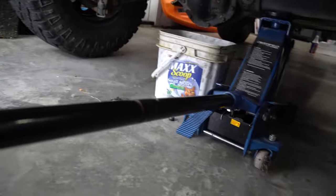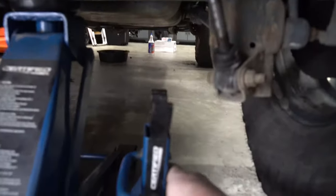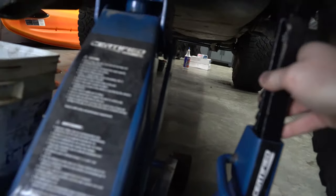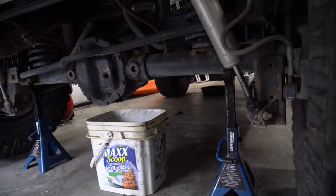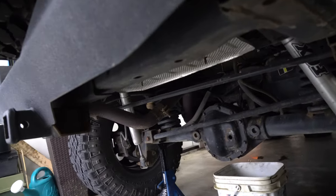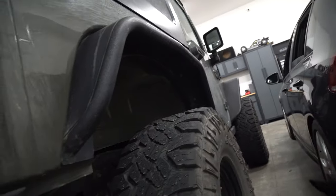I've lifted the Jeep on this jack right here just like so. Take your axle stand — jack stand — and see if we can put it at its max height. Maybe one more pump on the jack. That should be good. Once your axle is on both stands, as you can see I did not go very high off the ground. I just want enough that I can slide these tires on and off.